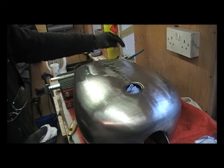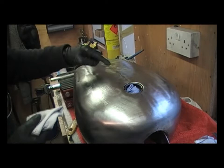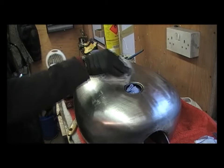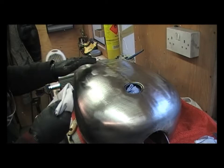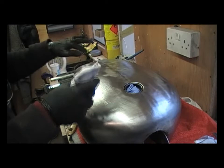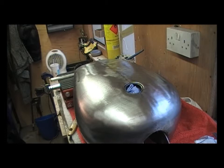What you do is you heat up the tank a little bit just to get it warm, apply the tinning — always go a bit bigger than where you want the lead. When the tinning starts to melt it'll turn brown. At that point you give it one wipe — just one wipe. Don't go over it and keep going, because the idea is when it burns you want to get off that burnt surface so you want it to stick to the rag. You don't want to push it into the tinning because it'll get under the surface of the lead and it'll blow through your paint. When you apply the tinning and it starts to melt, you'll see it start to shine — just give it one wipe, turn your cloth over for the next pass, and so on.